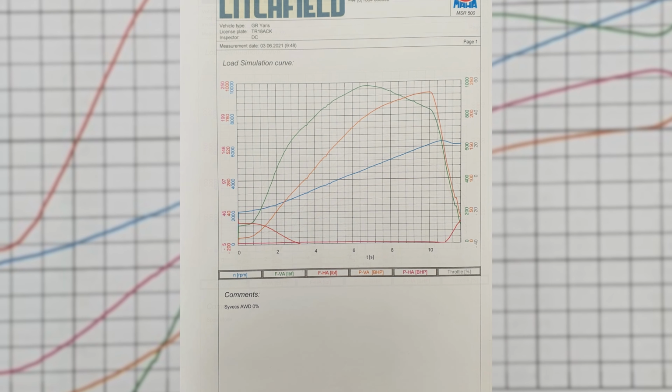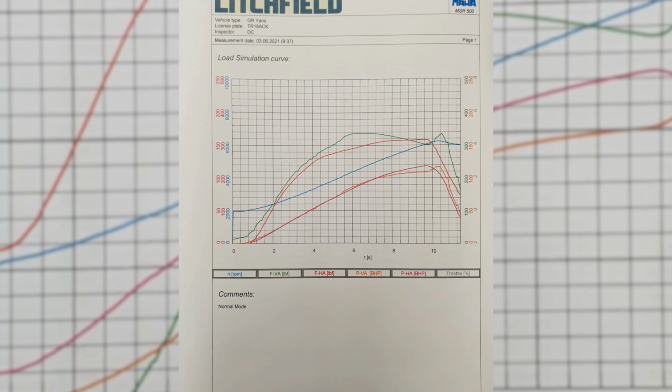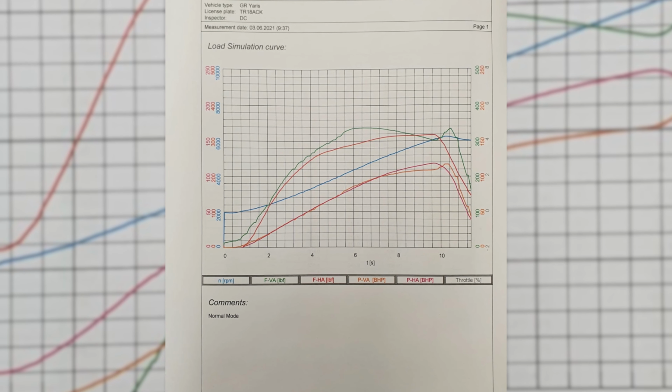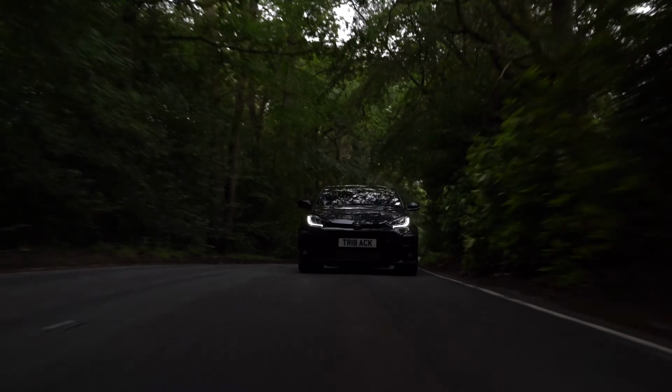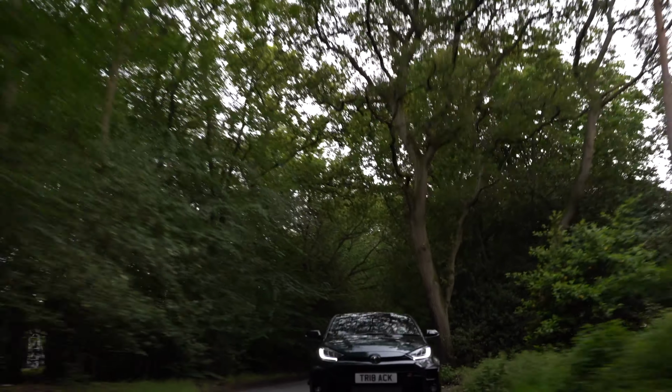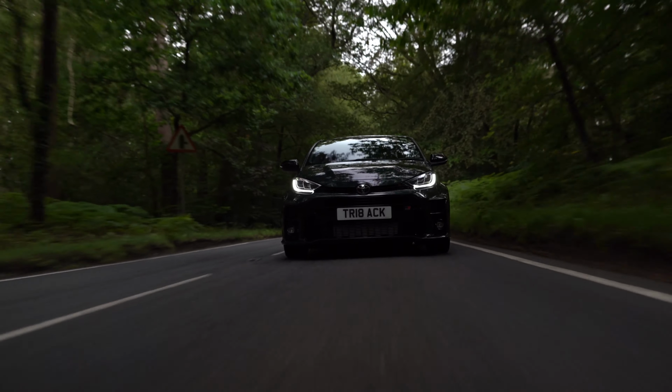And the important thing with that is that when you are driving it more at the rear, you are essentially putting more heat into the clutch pack. So we've done a really good job of being able to monitor the temperatures in the unit and, not just cutting the duty cycle to the rear, actually adjusting it automatically. The factory system, when it gets too hot, will just come up all-wheel drive overheat and generally put the car into two-wheel drive mode, which can be particularly dangerous if you're mid-corner. With our unit, it will automatically adjust the duty cycle based on the temperature of the clutch packs. And that's really good in ensuring safety when you are on the track and pushing the car.